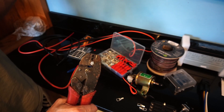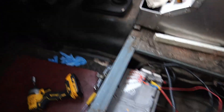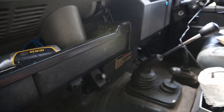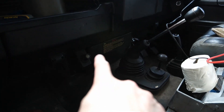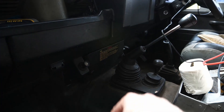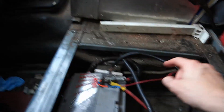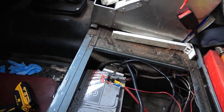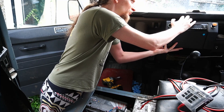The battery leads need to go onto the battery down here and I want the fuse box up behind this area somewhere. To figure out which way the wires are going, they're probably going to run down here behind the existing fuse box, and probably under the sound deadening or down where the gearbox is, then along and pop through one of these holes here. That way it'll be all nice and hidden, out of the way, and not going to be nicked or cut. So let's go with that plan.